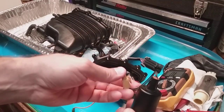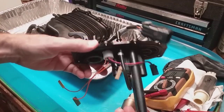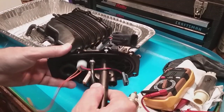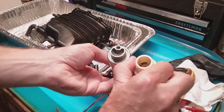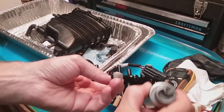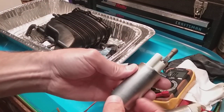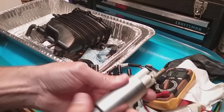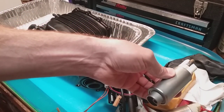They're saying the float has been updated, so I decided to buy one anyway — it's about $75 if you look around for an OEM. It's really not that bad, so go ahead and tackle it. It's definitely a do-it-yourselfer if you're pretty comfortable with it. These have some strainers in them that you can take out and clean. The high-pressure has a removable strainer; the other one you'd probably have to clean by pumping something through it. I bench-tested both my pumps — they both work, but this one didn't sound that great. This is the one that threw the fault, so we'll see what happens after I put it all back together — hopefully that's the issue and there's nothing else going on.